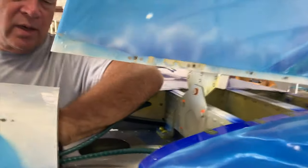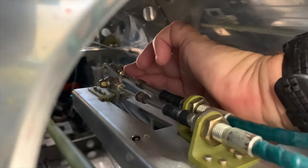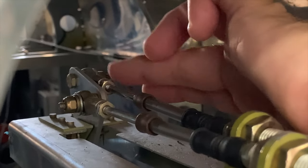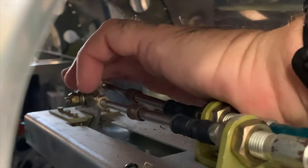You've got to reach your hand way up inside here, which I did on this one that came in for a condition inspection. I just spun this off with my finger — can you see that turning in there? Please don't forget about these two jam nuts. There's both of them, and on this aircraft both of them are in fact loose.